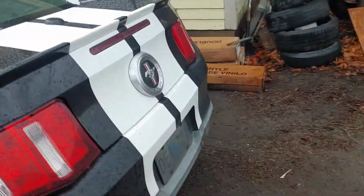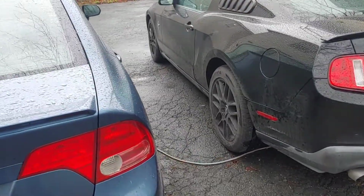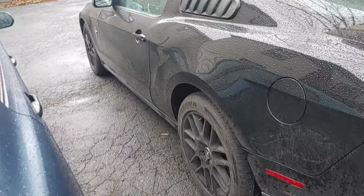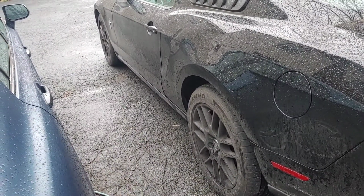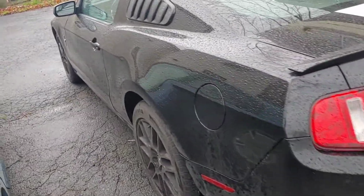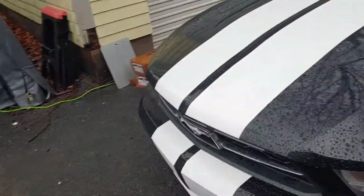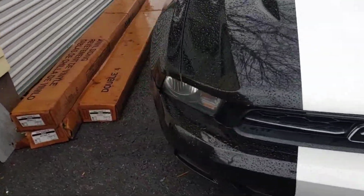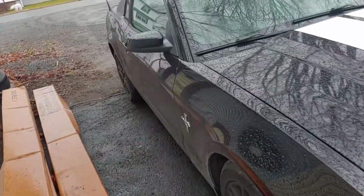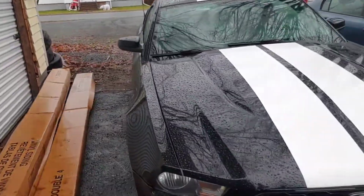And so the only thing we're going to do is get it geared up for the winter. We've bought some studded tires. So we found 4 studded tires. We got some steel wheels. And we're going to give the car an oil change and spray a little bit of undercoating on the underside. So that is really going to help protect it. Spray the undercarriage, squirt some inside the rockers, inside the doors. That's what we have to do here in the Northeast.